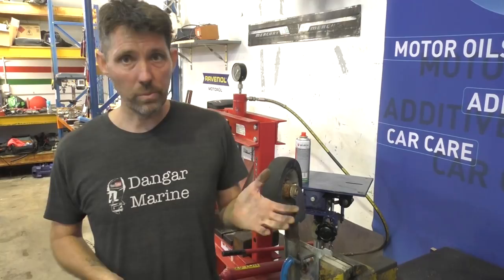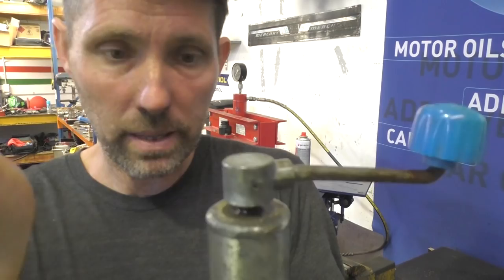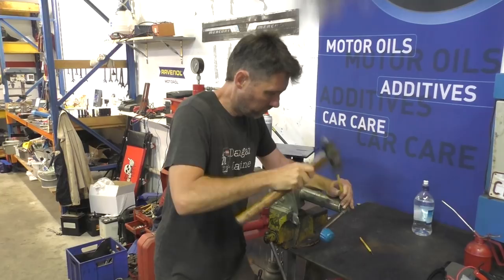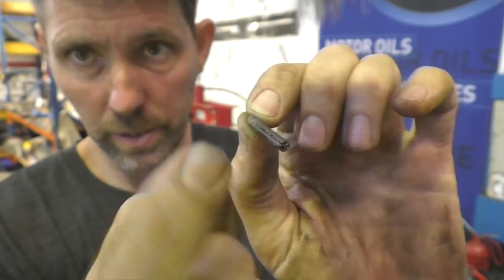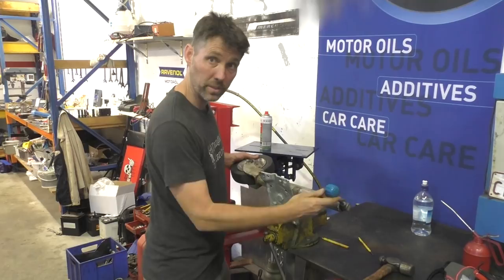See whether we can clean it up and get it going again, because they're about 70 bucks each so they're not super cheap. In the top of the handle there's a roll pin that holds it in, so I'm going to push that through, get the handle off, and see if we can just get the whole thing apart. Roll pins are also called spring pins depending on where you're from, and either way you just punch them through. There's the pin — came out pretty much intact. You can see it's got that seam along the center so it sort of springs together and can push out. With this one you get a little bit of independent movement — it spins and I can move the handle within a certain arc whilst holding the wheel still.